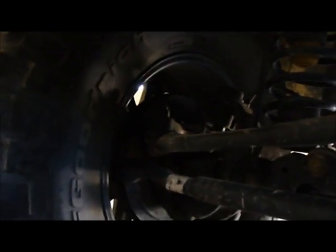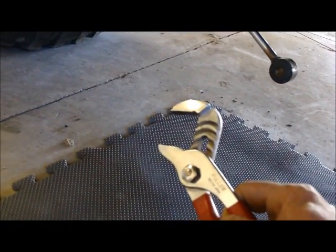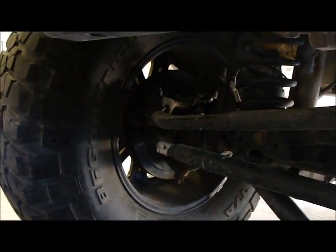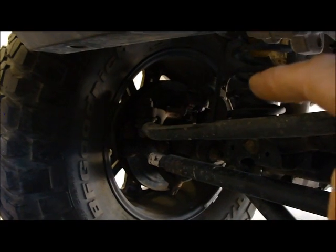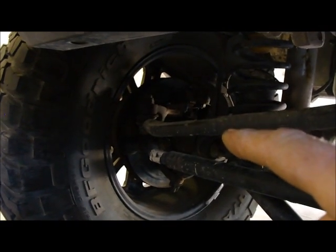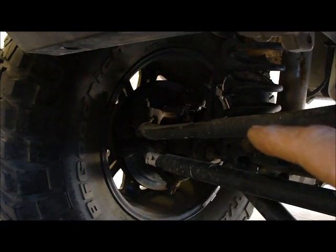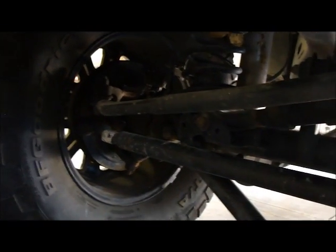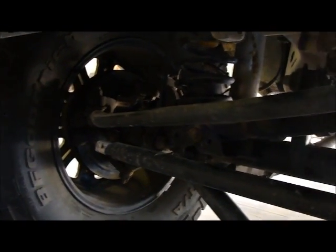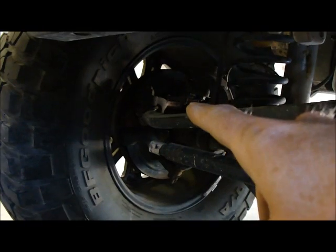I would do the same thing at the knuckle end, but the pliers that I have here at my friend's house aren't long enough to do what I need to do. But that's what you would do to check. In this case, we're going to check the torque specs for that drag link end at the knuckle side, and we're going to see how loose they are. If they're appropriate, then we know that that end is worn, and what my friend needs is a new drag link, at least the end that goes from the adjustment sleeve down to the knuckle.